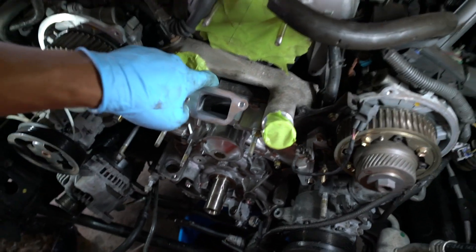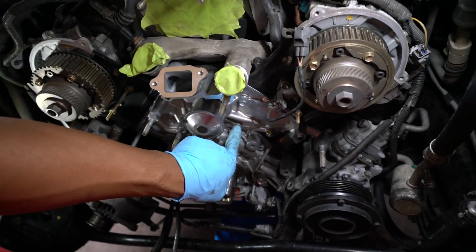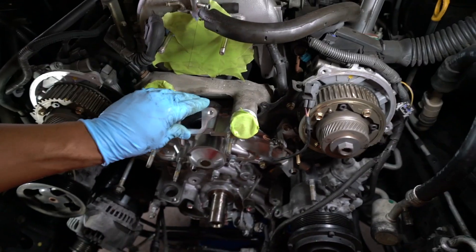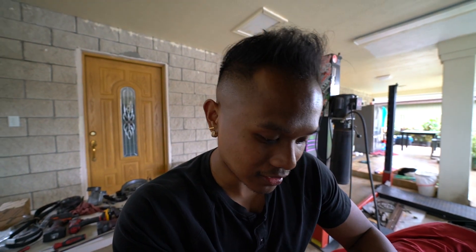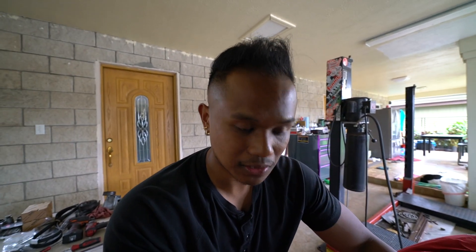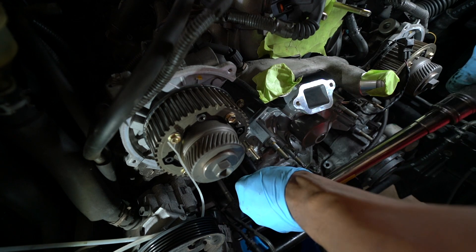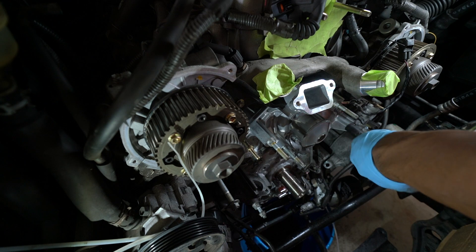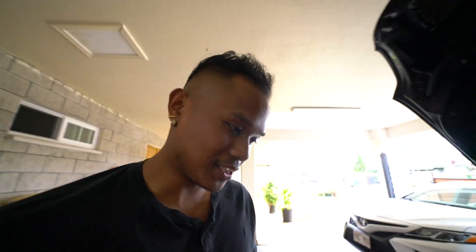We got the new water pump in. There's an O-ring right here — don't forget to change that, it should come with the kit. There are eight bolts — one through eight. Give it a little tap and it should pop right out. It had a little hard time coming out, had to give it a good tap because it's a mated surface. Got the new gasket, new water pump in, new O-ring — we're going to torque this to spec. Torqued all the water pump bolts. Now I'll work on the crank seal — get the old one out and put the new one in.